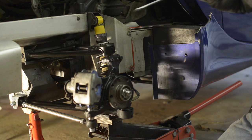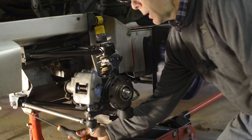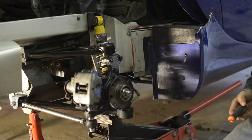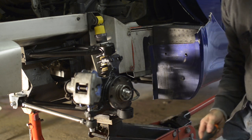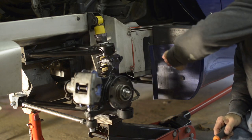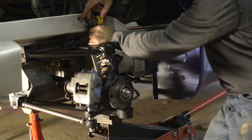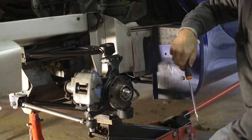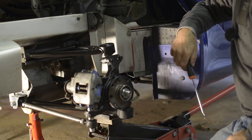At the back of the car the wishbones are mounted on top with one bolt here, one bolt there, and another bolt on the bottom connecting the toe link, plus one more further under the car. You'll have to undo the aluminum protection plate underneath. If the clamshell is on, remove the inner wheel arch to get access. I'd recommend removing the shock absorber for easier access.